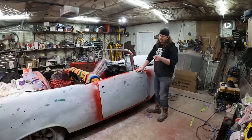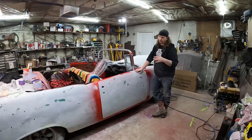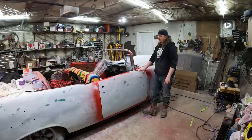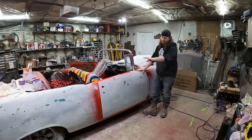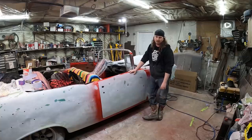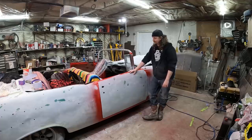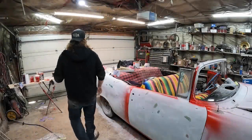A 1.4 tip. And I think I put the paint on a little too heavy to start. I'll let you guys send in the comments — I was talking to other people. Kind of put a medium coat on and then do two or three heavier coats. And even if there's a little bit of orange peel and stuff like that, we can polish and wet sand and do whatever we've got to do. We'll block all the rest of it down to probably 320 or 400 — we'll see how motivated I am. I'd like to get some paint in this thing.